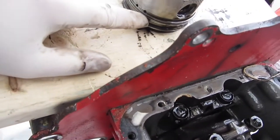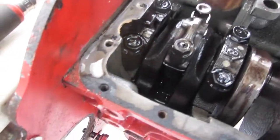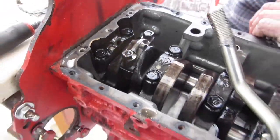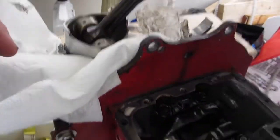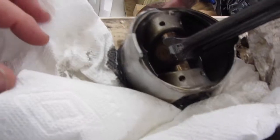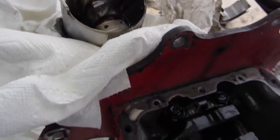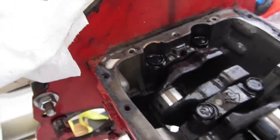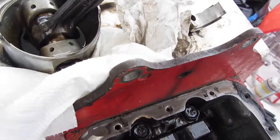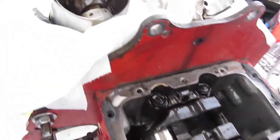We got the rings loosened — just tapped them with a wooden hammer and they freed right up. The rings are supposed to be 90 and 180 degrees out from each other; there's a pattern to the alignment specified in the manual. If your piston is not pinned, they can rotate — and they're supposed to rotate. So now you have an opening on a stuck ring, and the other ring rotates to where the opening is, and you have no compression. That could be what's going on here. The pistons don't look bad — we'll still crosshatch the cylinders. I want to get that lifter out so you can oil it — put oil on everything.